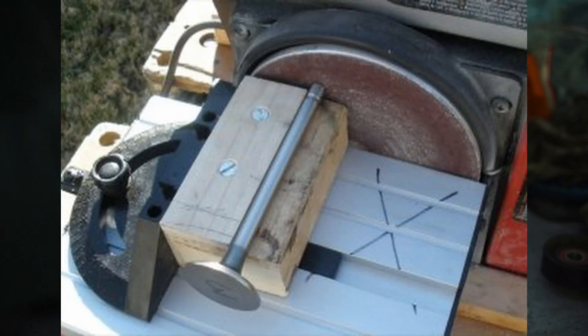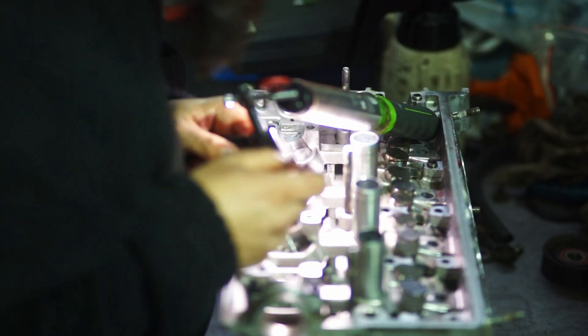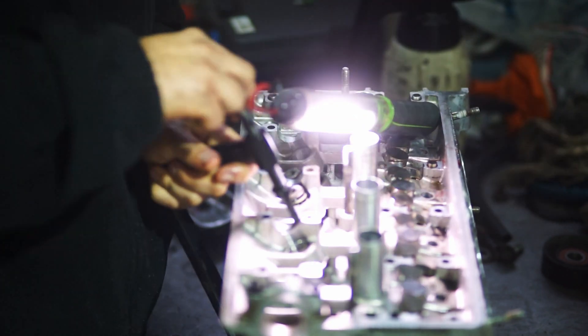If your lash is too small you can grind down the lash caps if you have them. If you have normal shims instead of lash caps, those aren't easily ground and need to be very flat; you can also get the valves shortened slightly, which needs to be done by a machine shop for precision. The easiest way to determine how much you need is to start a spreadsheet listing everything, writing down what you need versus what you already have.